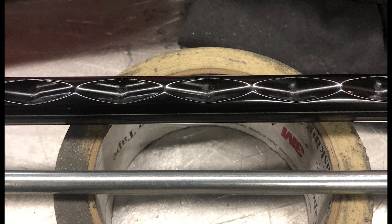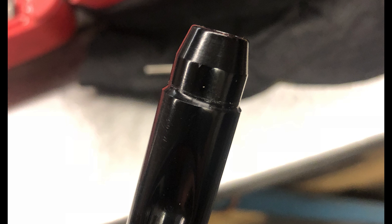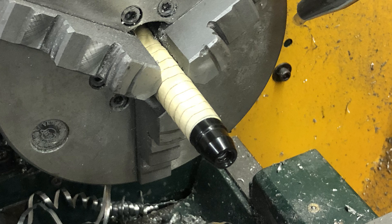It's a nice piece — quite a bit beefier than the standard piece, very happy with it. We quickly disassembled it, pulled the stainless threaded inserts out, and were left with the raw aluminum shift rod. The plan was to lathe it down to the first shoulder you can see in the picture — take the taper all the way off, then give it our own taper — and that should give enough clearance to run the shift rod. Here you can see what we did in the lathe.